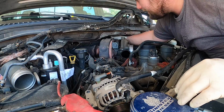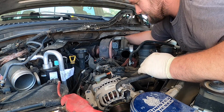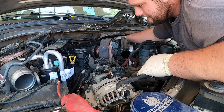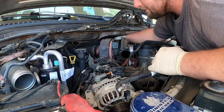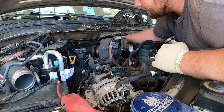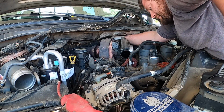Once I get this turbocharger out, I'm gonna have to let them know I'm gonna need that inlet, because I'm supposed to have this done in 2 days. And I have to replace the EGR cooler. I'm gonna do 4 injectors on the driver's side, and I gotta do a cam sensor. And I'm hoping to have all this done today. And right now it is about 2 o'clock.